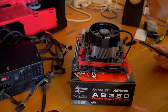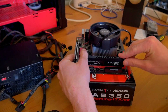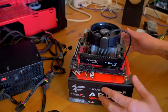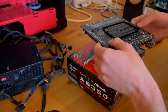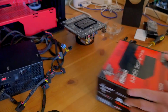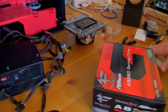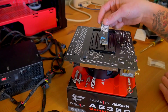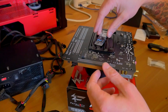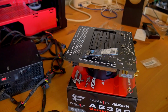Currently using only one stick of RAM, so we'll use the B slot. For the love of gigs, I'll go ahead and install the M.2 drive — keeping in mind that earlier when I said I didn't need anything from the box, I will actually need the M.2 screw. This is the Toshiba RD400, one of the better budget NVMe drives for price-per-gigabyte, factoring in speed.